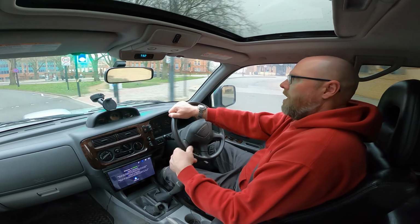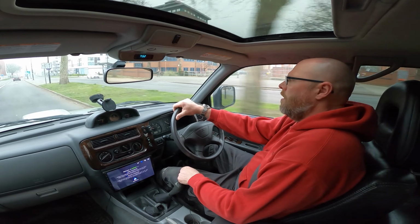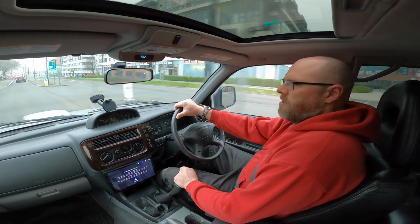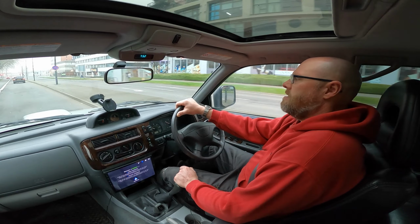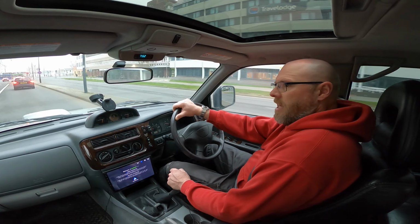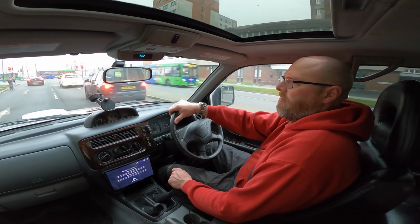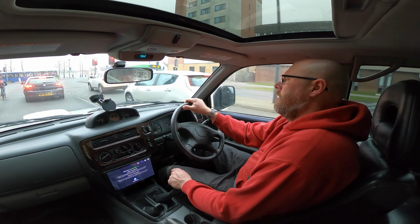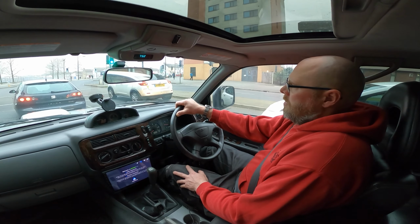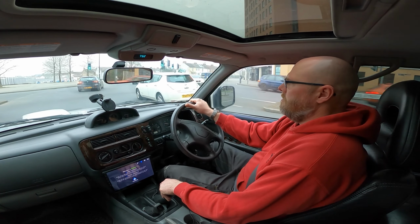Then I've got to get Steve's vehicle, his Q7. We've got to add on a thing called the SSR4, which is basically like a resistance. It's supposed to simulate standard speakers when you add amplifiers to OE systems. I had a word with Lee yesterday regarding the amp. The Audison people found no fault with it. They've said there's nothing wrong with it. Clearly we have got a problem. But they've asked me to add on this SSR thing to give it a resistance.